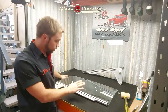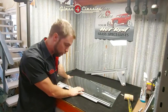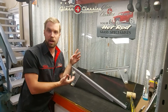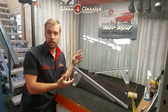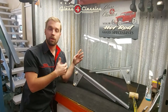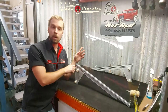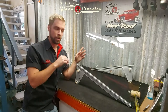What I would recommend: when you do get the final adjustment with this sitting in the door, use bearing grease on these guide wheels in the back. Everyone's got a tin of bearing grease sitting around for the trailer hubs. If you use any lithium greases like white grease — they did use it from the factory — the issue is that they require movement. Without movement, it dries out and goes crusty. By using the bearing grease, it will not dry out and it will make it a much smoother operation on the final install.